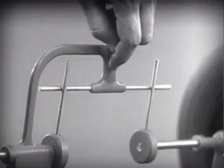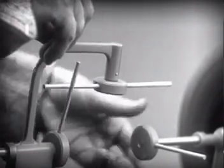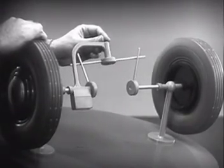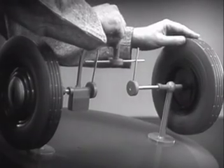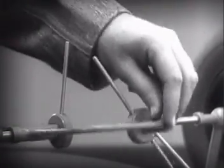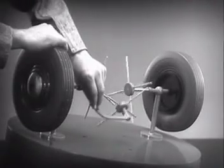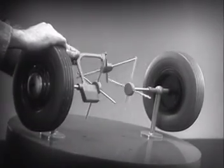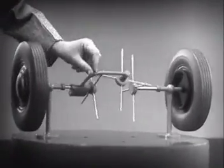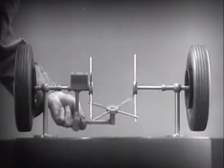Let's put this bar on a pivot so that it can swing in either direction. Now the bar can still turn both wheels at the same speed, and because it pivots, it lets one wheel turn even when the other is stopped. But if turned too far, the bar will swing around until it won't drive the spokes that turn either wheel. We need another crossbar and more spokes to carry on the job. Now, when we stop one wheel, the crossbars will continue to push the spokes of the free wheel around. As long as both wheels are free to turn, the bars do not swing on their pivot and the wheels move at the same speed. Now we have the working principles of a differential.